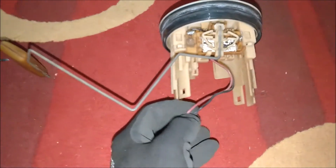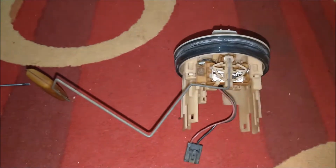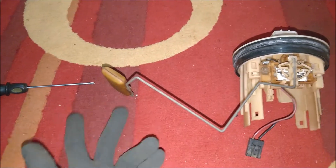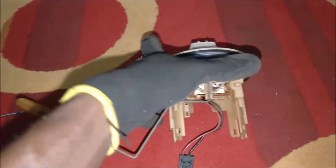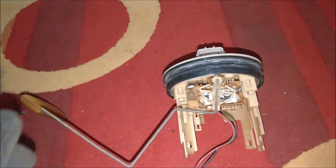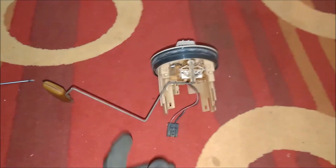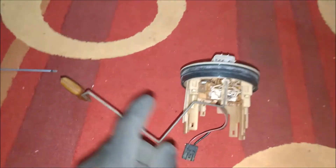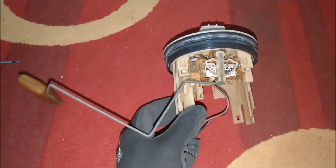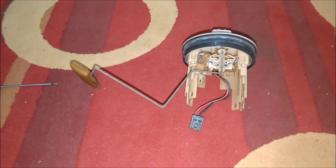It was time for this because even the wiring to the pump was pretty brittle — hard and brittle — so it's not very reliable. The color also tells you how much service life the item has seen: when new, they'll be white or cream like the top side; the more life they go through, the browner they get. So when you're shopping for one of these, it's better to get an item that is less brown because it means it has less service life on it. Until next time — this one ends here, thank you for watching.